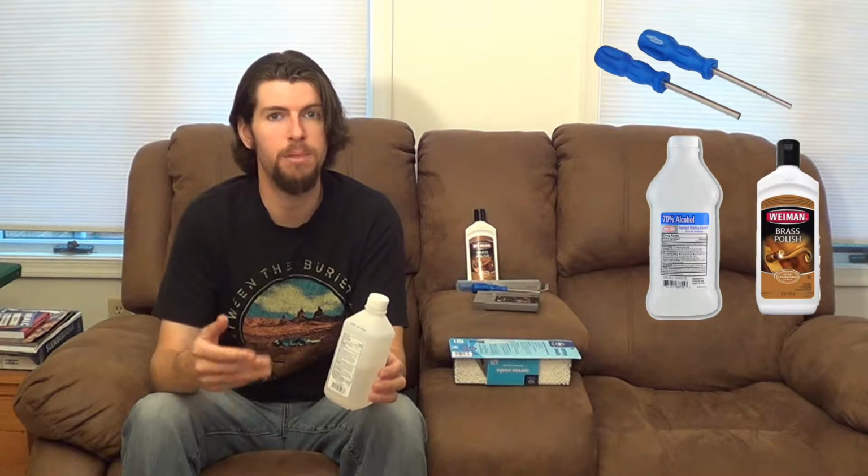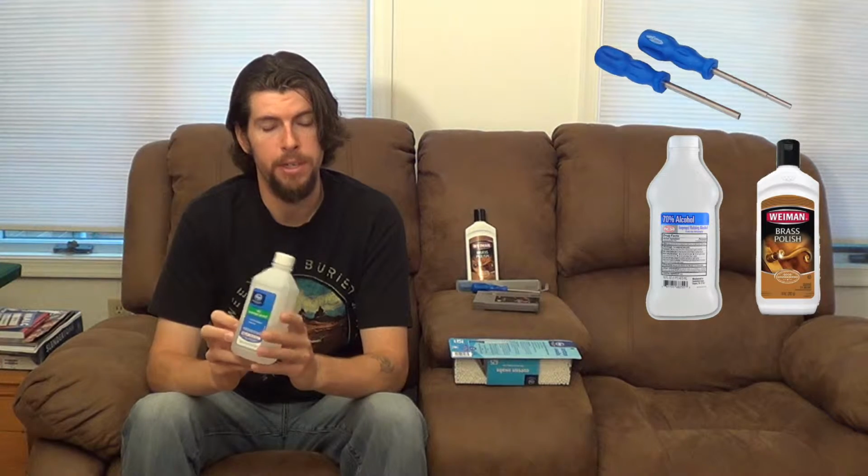Next, we're gonna need some rubbing alcohol. Now, I prefer to use 91%, because really, the higher percentage you can get, the better. You don't want anything below 50%, because then it's a lot of water, and you want to try to keep moisture away from your cartridges at all costs. So, that's why it's best to go for a higher percentage. You can get 50% and above, and that's what you want to aim for. Like I said, 91% works pretty good, because the higher the alcohol percentage, the faster it will evaporate when you're cleaning with it.